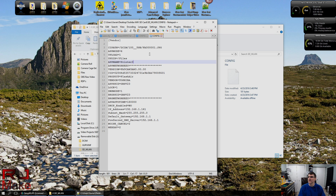This is what the config file looks like before the Toshiba Flash Air tool has touched it, and this is what it looks like after it's been initialized with the added settings. Quite a few of these you need to add manually. One is 'upload=1' — that has to be in there. The second is 'webdav=2' — that must be in there. And because you want to map the SD card, it needs a static IP address, so you need to add that IP information as well. I'll leave a copy of these files in the description.